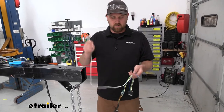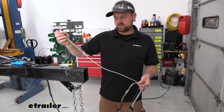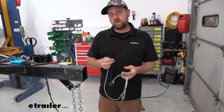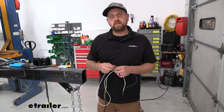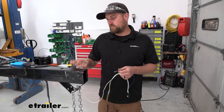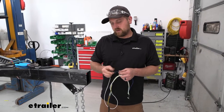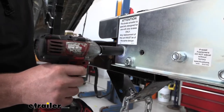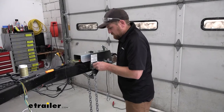As far as the blue wire and the white ground wire: for the white one I added a couple feet of wire to it since I'm not sure yet where I'm going to ground it. The blue wire will get hooked to your reverse light circuit — whether for reverse lights on your trailer, or in our case it's going to go to the actuator on our coupler for the reverse lockout. Before worrying about getting these hooked up, I want to get our coupler on so we know what we have to work with and can get everything done at once.